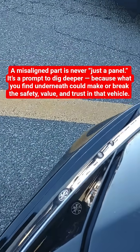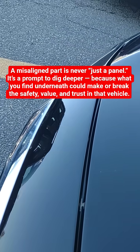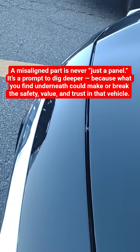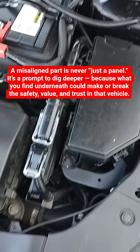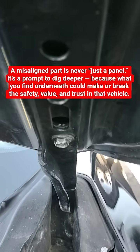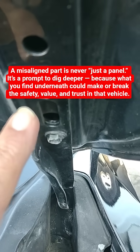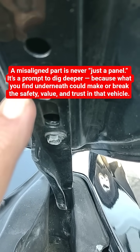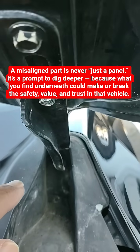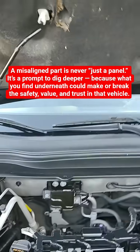Let me open the hood to see what's going on. As you can see, the hood hinges — the screws on the hinge with the hood — were definitely removed. That could mean this hood was replaced, or most likely was replaced.